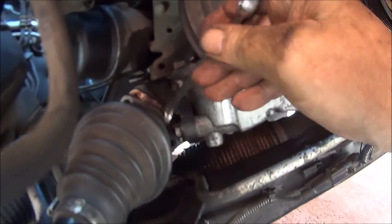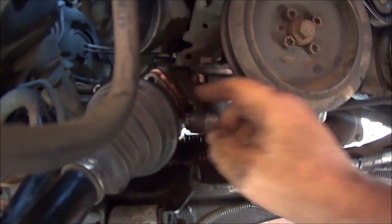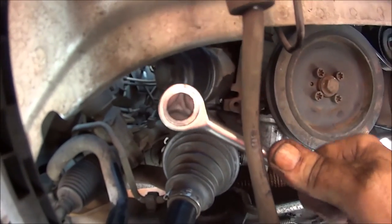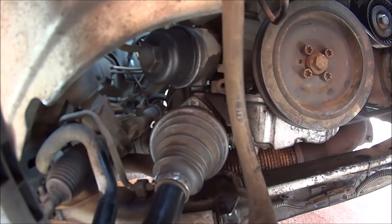So that's all that buttoned up. There's a little wire this side and on the other side there's a little pipe that fits on — and that's that done. I've got all these bolts in. I managed to reach this one from this side, the other two you have to do from under the car. I've got to get that nice and tight, and I've got to force this drive shaft back into the gearbox, then I can put this flange back on and get this final bolt back in — that's a 12mm socket.